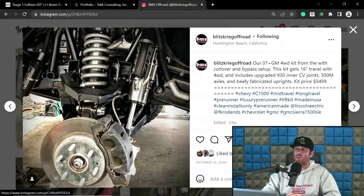So the other thing you've got to look for is, if I'm going to mess myself up by having the steering rack location in the chassis too far rearward, and now I'm putting way too much Ackerman in the system and going to oversteer the interior tire and not have the exterior tire steer enough, that's going to be pretty disastrous, especially for street driving applications. Or is it going to be beneficial if I move that upright forward and get myself just a little bit more Ackerman, you know?